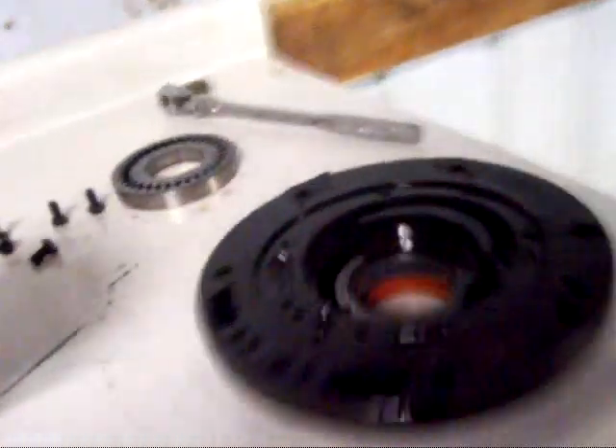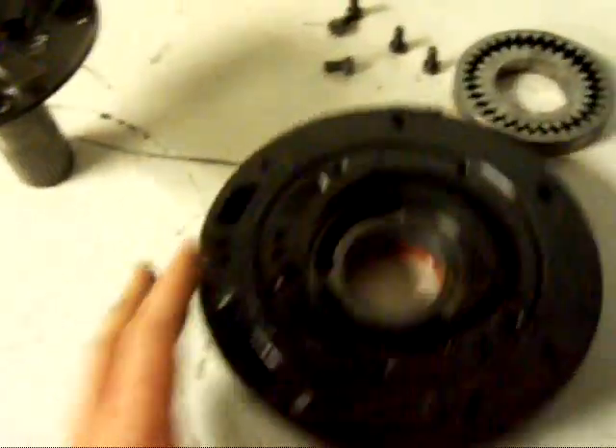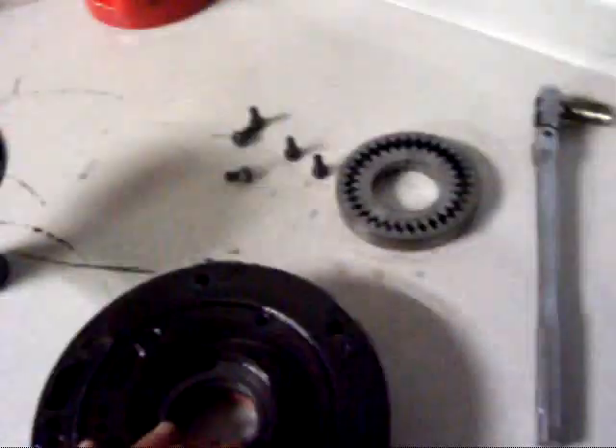Now I've got to knock that seal out, clean everything up, and I'm ready to put it back together. Now that I've got the pump apart, I noticed a few things. This dot — this is exactly the way it was facing in here, but this dot should be the other way. So basically the inner gear was installed right but the outer one was installed backwards. The bearing in there is all chewed up — that's no good. And the seal looks like somebody just smacked it in with a hammer. I've got a new one, but I'm not sure if I want to get a whole new pump assembly or try and replace this bearing. I don't have the exact tool for this part but I have a cam bearing installation tool that might work. I'm going to have to look at part prices and see what I want to do.